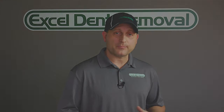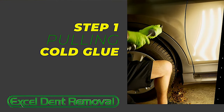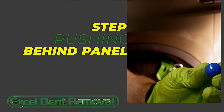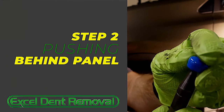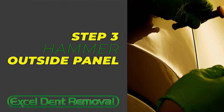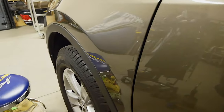Now you've seen the three-step process used to remove large damage like this with paintless dent removal. First, we used the cold glue pulling method to take out the bulk of the damage. Two, we got our PDR tools behind the fender and pushed the damage out from the inside, which takes finesse work and smooths out the panel. And three, we used the knockdowns and hammers and blending to push down that large crown, push that damage back into the dent where it goes, and blend out the outside of the panel to make it look great.